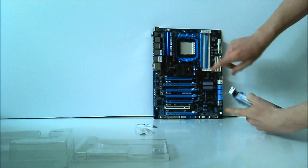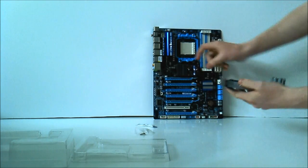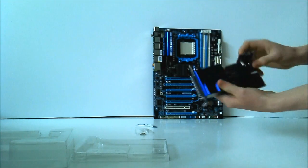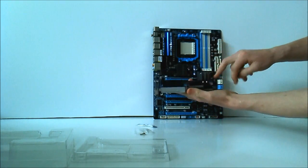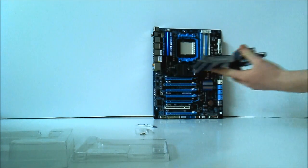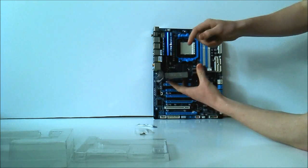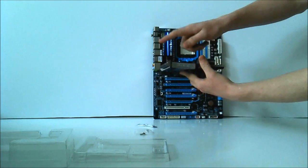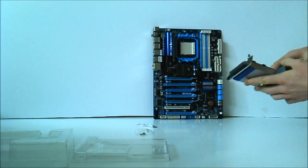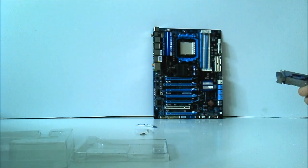What you do is these 2 screws on the water block, you unscrew them and that block comes off. This is then attached on there after applying the thermal grease and screwed on with the 4 screws. Must note you have to install the motherboard first and then install the silent pipe, as it will attach to your case through one PCI slot. The motherboard is 1 slot longer than normal motherboards. It is an extra large ATX motherboard.